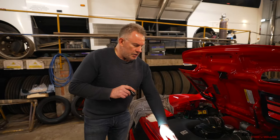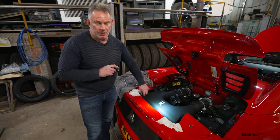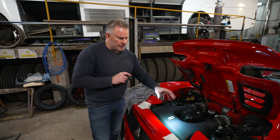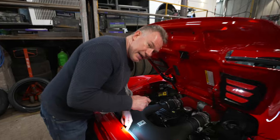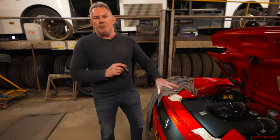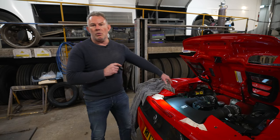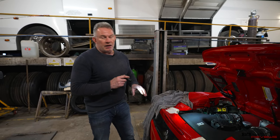The next stage is to loosen off and remove the top air filter cover. Once we move it, we'll loosen off the locating bolts for the bottom of the air filter cover. That should provide access to move the air filter cover to the side slightly, giving us access to the cables that attach to the valves. You can actually see the cables down there, but you can't get your hand through to reach them. Once loosened, we'll connect the cables and run them across the crossmember and along the existing wiring loom.